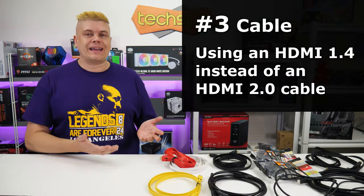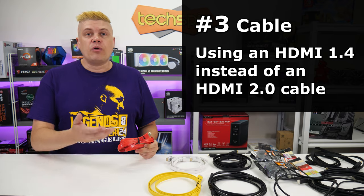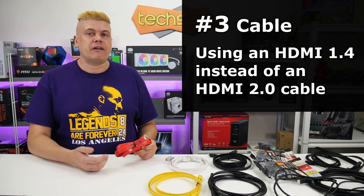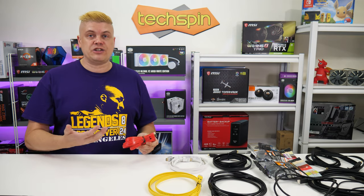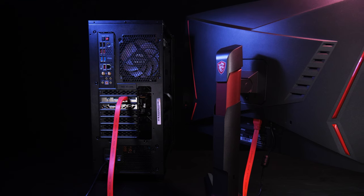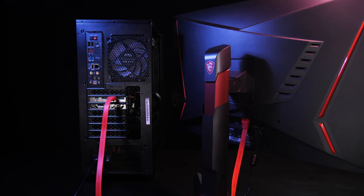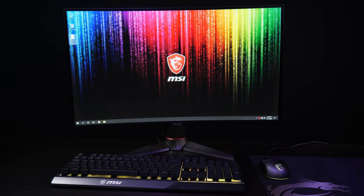Finally, the tip that will help you the most: the HDMI cable itself. While an HDMI 1.4 cable is more like a garden hose, an HDMI 2.0 or 2.1 is more like a water pipe, able to carry way more. Physically the same size, the internal wiring is designed to carry the huge amounts of data that 1440p 144Hz and 4K 60Hz require. With an HDMI 1.4 cable and a 4K 60Hz source, you'll only connect at 4K 30Hz — and this is how you can test unmarked cables. Rarely, short HDMI 1.4 cables might work at 4K 60Hz, but they may not be stable long term.